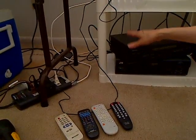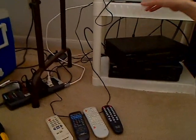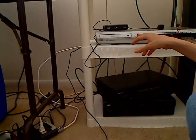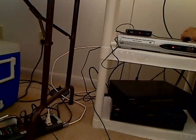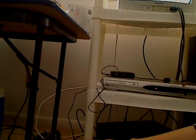Then from your VCR, you want a cable line that goes out to your DVD player, going into the input slot for your DVD player. Then from your DVD player, you want a cable line going out up to your television set. My hookup for my television set is in the back. So you've got an out from the DVD into the television set. That's how you set up your cable lines.